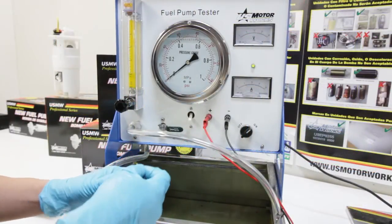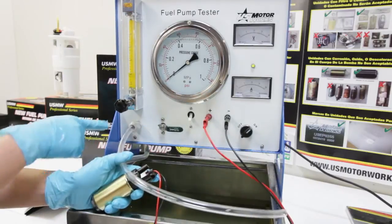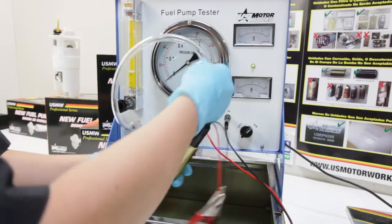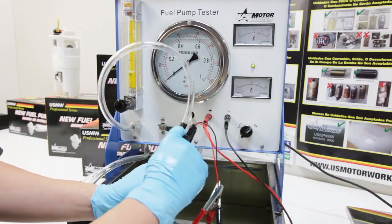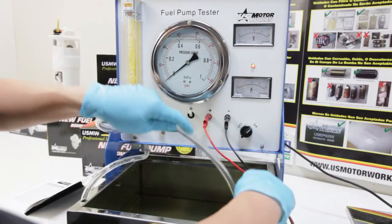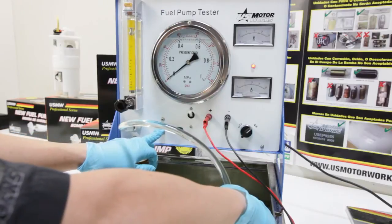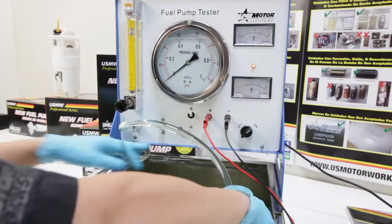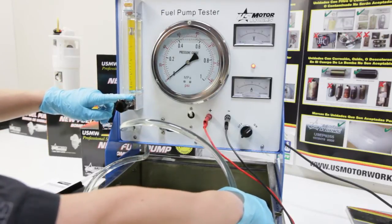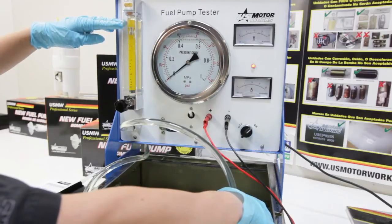After you verify the unit is functional during the dry test, you can move to the wet test procedure. Disconnect the tube from its mounting position — it's the tube that goes into the front face of the tester — and attach it to the fuel pump with a side-to-side motion. Engage about half of the fuel pump output nozzle, which will be adequate for testing. Turn on the fuel pump power and put the fuel pump into the liquid. With the lever in the horizontal position, it is ready to read maximum flow rate. This pump is supposed to make 160 plus liters per hour, and reading from the top of the float, we have 160 plus liters per hour — flow rate is good.